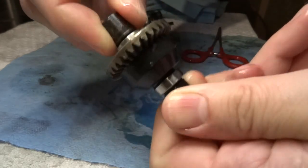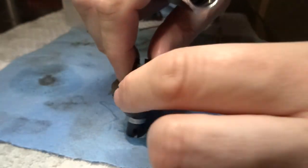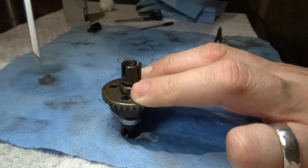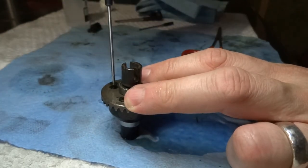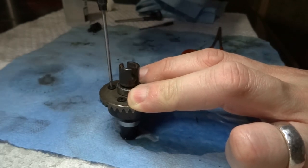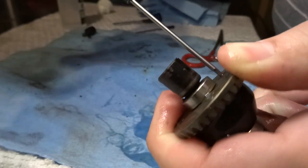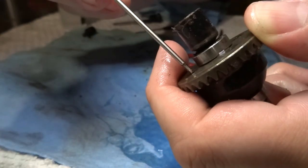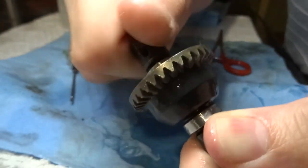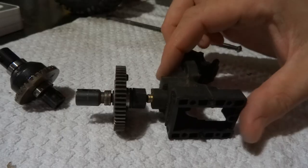You can feel the diff working. Now I'm going to finish putting all the screws in. I'm going to take it down until it gets kind of snug and just keep working my way around — just enough where I can feel it tighten up. Diff is complete. Now I can rebuild the car — the rear transmission.